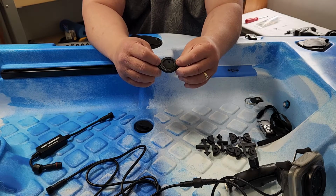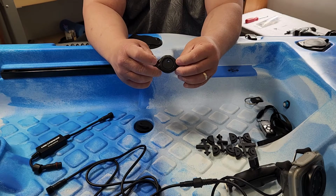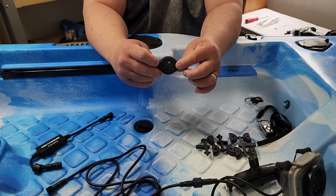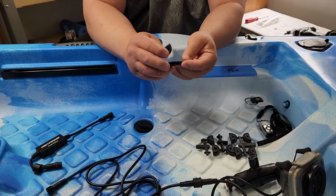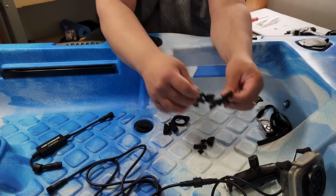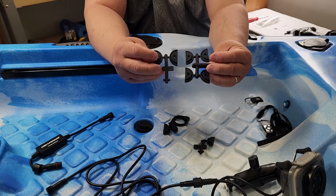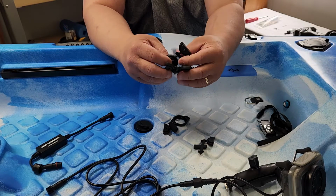Once you have the slice and you pick the grommet you're using, you're going to install it in the cap. And once you install it in the cap, you're going to put the cap on the 1-inch hole that you drilled, and drill a pilot hole for your screw, and then put the screw, and then drill another pilot hole with the drill bit and put your other screw. So once you got both screws in, you're going to take the cap off, take the grommets, and then run your wire and do the installation. The nice thing about this setup is that you have different sizes and they're all labeled by letters for different cables and different wires, which is nice. So it's got multi-application uses.